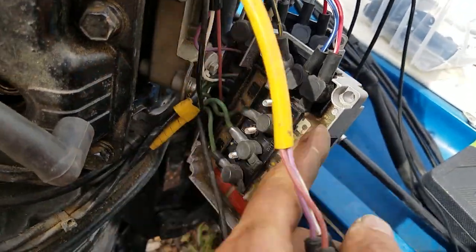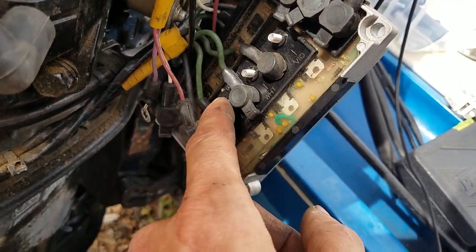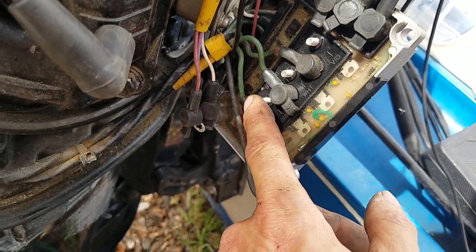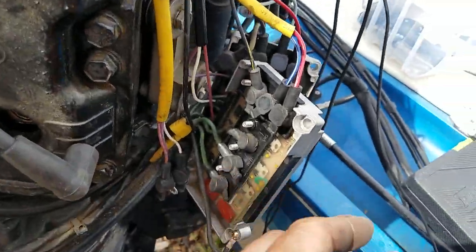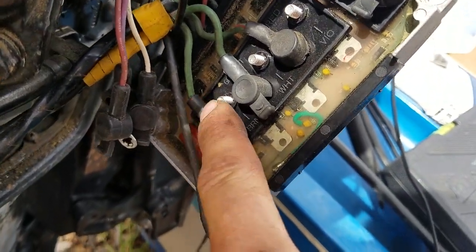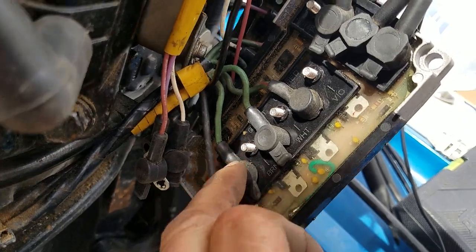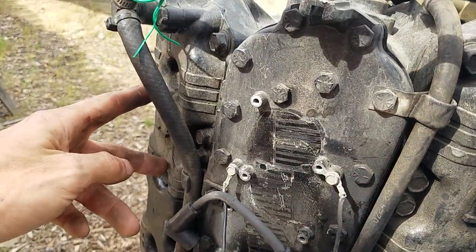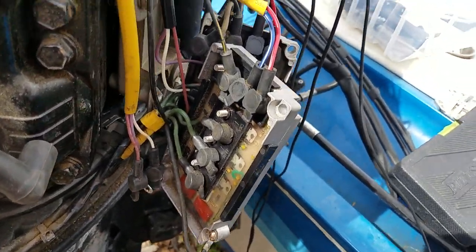The firing intelligence in this whole pack only comes from the trigger. I'm saying this because you can have one of these channels go bad. On this motor it's cylinders two, four, and six. If this cylinder over here doesn't have spark, or it's intermittent, but the other two are good, I can take the two wires from here and swap them with the two wires from another pair, and swap the plug leads to the corresponding cylinders. And if the problem moves, it'll tell you what's wrong.